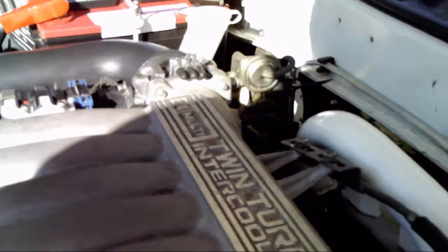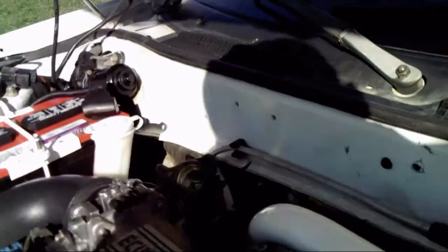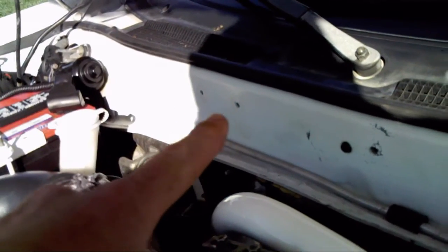Took the ground wire, removed it. There's a ground wire I believe connected to this hole, and I moved that bolt, and it's working out just fine. Put the EGR delete plates on there. You can see one there, kind of, it's a little dark, but obviously removed the EGR solenoid. That was part of that solenoid pack that was right over there on those two holes there.